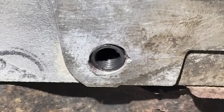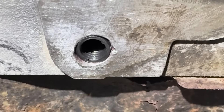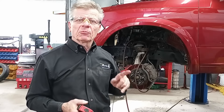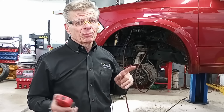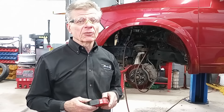A real nice clean job on what would have been an absolute disaster — the cylinder head removal, machine shop tap, etc. But Chuck was able to get it out right on the truck. Chuck was successful. He was able to tap it. You saw the steps, saw the tapping and how easy it was. We tapped it down, cleaned all the remnant out of it. The insert is in, one drop of Loctite, and we're going to let it cure overnight. That was an alternative to pulling the cylinder head and sending it to the machine shop. A tremendous amount of time saved from a previous botched job. Chuck was a hero and he got it done. Thanks so much for watching — check more out at our website at ProMaxTotal.com.